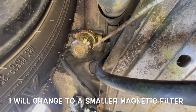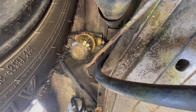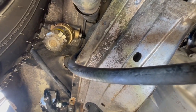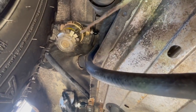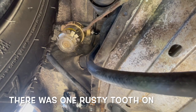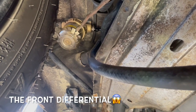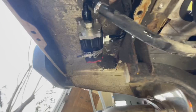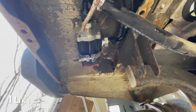This example is a bit extreme — I'm just doing some testing, so I have this huge magnetic filter with a visible bowl because I want to observe this one gearbox. This gearbox sat for 31 years unused and I wanted to make sure it didn't have any rust coming through or chunks of gears coming apart. I don't see any problems so far. Anyway, it comes out of that magnetic filter and into this 8-micron filter — this is a fuel filter.